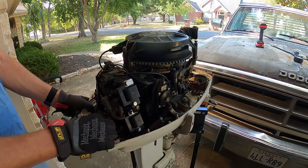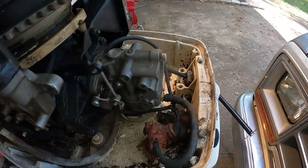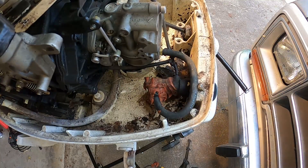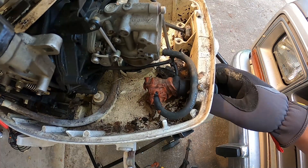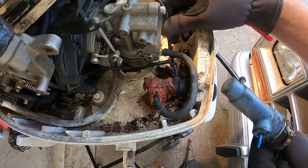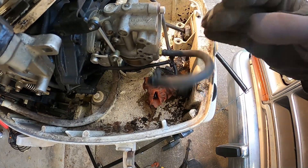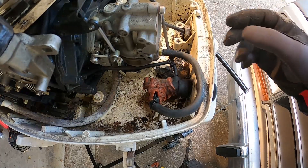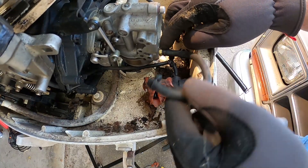Plug wires back in. Here's the next thing we need to take care of before we try to fire this thing up — I do plan to fire it up before pulling the carburetor. The primer was fixed by somebody with a bunch of silicone, so I have the new primer right here. This hose actually still looks good — not collapsed or anything — so we're just going to go ahead and reuse it. If we have any leaks we'll change it out, but for right now we'll run with it.